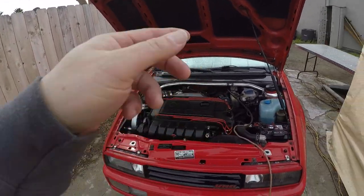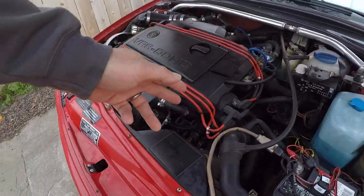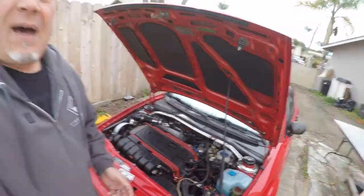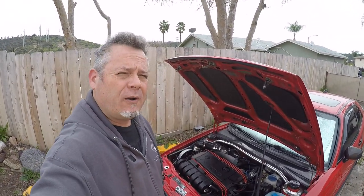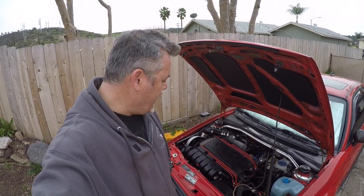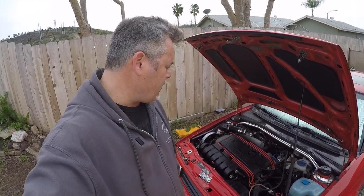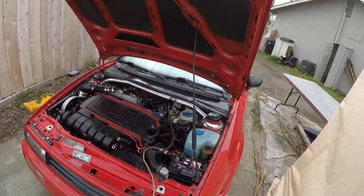This is not a giant problem, so tune in as I deal with the coolant flushing and changing out these housings. We're going to do a flush — I'll get a couple bottles of the coolant flush stuff, run it through, let it warm up, let stuff leak out because of those leaky flanges, and flush it a couple of times. I do have the metal housings made by — I think they're Audubon Auto Works — and we will be popping those on there. That should buy us a good amount of time without them warping and causing issues. Then with the new flanges back on, we'll fill it up with fresh G13. Unfortunately, that means even though the supercharger is now working again, we can't drive her just yet — one step forward, two steps back. Such is the nature of Corrado ownership, but she will rise again. So tune back in. Make sure you hit like, subscribe and share. Appreciate that. God bless you. See you soon.